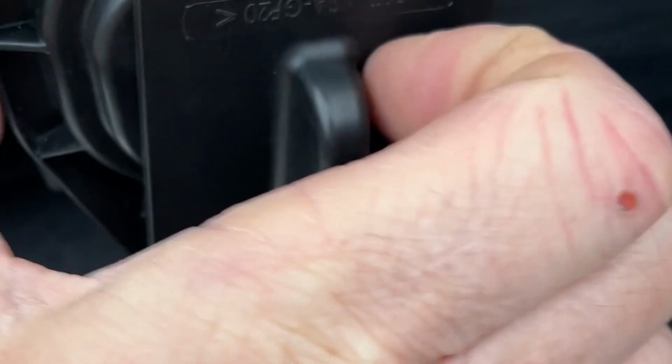So I've got the headlight in the back. Take the case off the back of it, slide that across, pull that off. Then you can see the headlight there. So pull the connector off. Make sure it is the right headlight. Obviously look at the front. So yeah, that is the right one.